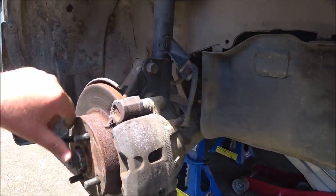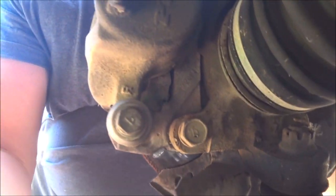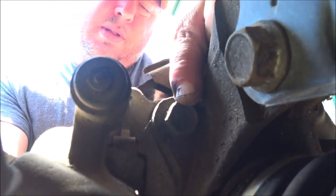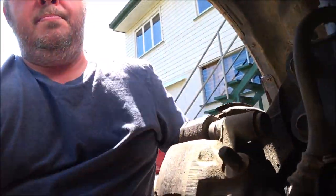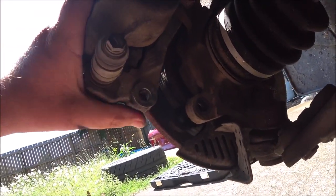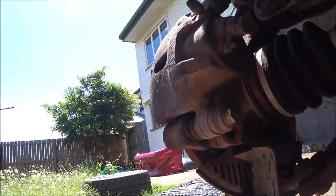So, we need to undo the caliper and have a bit of a look down here. There's a bolt, that one. Up here there's a bolt, there's this one. So I'm just going to undo the bottom one entirely, loosen this one, rotate that up. So, this one undone. This one just loose, pull that out. We can just lever this up. Hopefully, it'll clear. Nah, it's sitting on the...